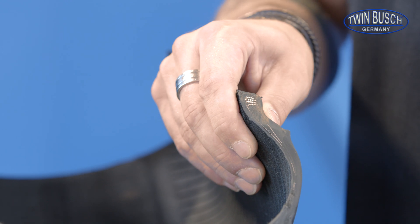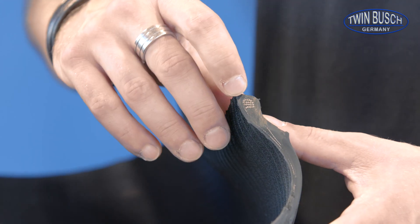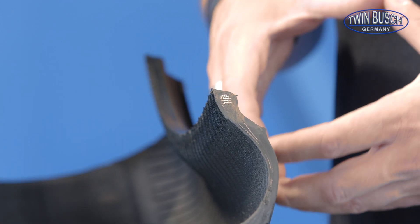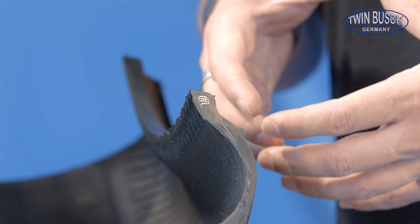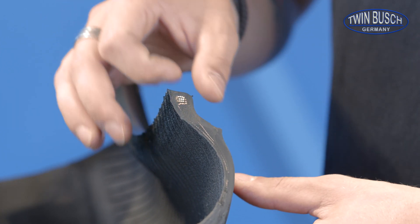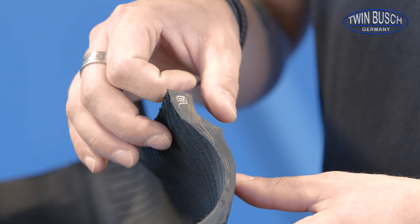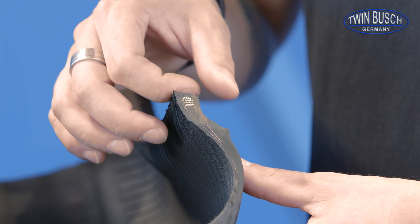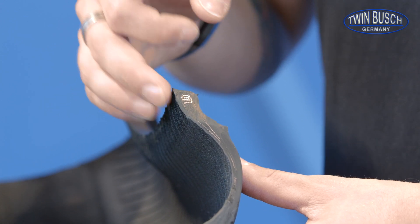Specifically for the tire bead: the wire core is embedded in the tire bead and forms a ring throughout the tire. This ring is stable and firm and also forms a tight fit on the rim. Briefly, the rim flange is on the outside, the bead lies on the barrel, and the hump builds a seal from the inside.